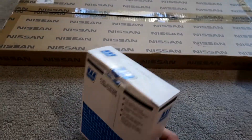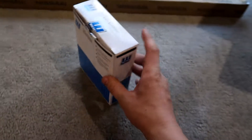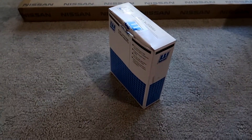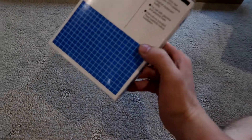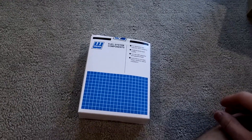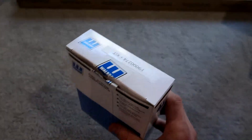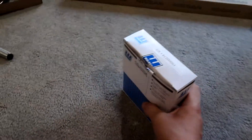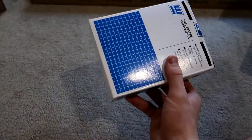Next thing, we ended up getting a new Walbro 460 fuel pump kit. It comes with a brand new filter and new wiring. His pump has been sitting out of the car with no fuel running through it for so long, and he is on straight E85. He's actually putting a new tank in as well — his R32 tank was very rusty. We just thought we'd put in a new fuel pump and rule out any issues. We want to make sure we're getting nice clean fuel pumping through the system.